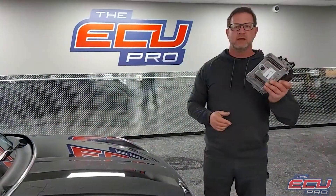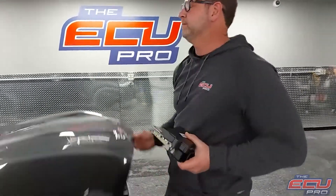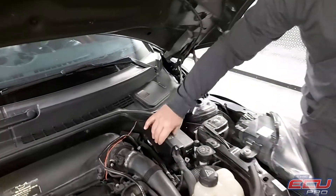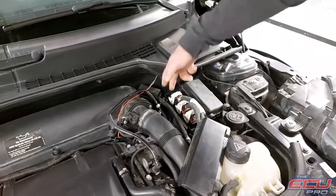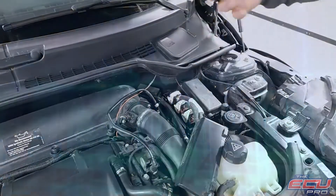To remove the DME, first thing you can do is take the key out of the ignition, make sure the car's off, pop the hood. It'll be under this black cover, just slide the cover off, undo the three connectors, and take a flathead screwdriver on this end and this end, just start prying up gently the computer, and it will slide out.